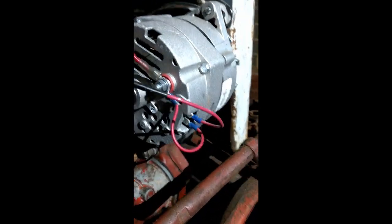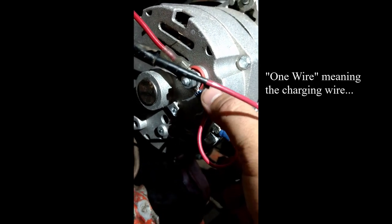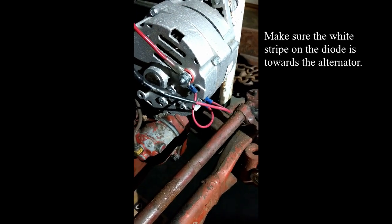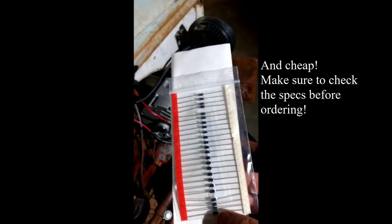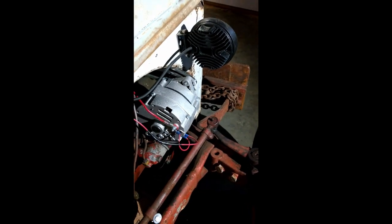Thank you, Google. There was a rubber plug hiding two terminals on this. The bottom terminal here — terminal number two — is jumpered to the one wire. That's constant hot. The second terminal, which is actual terminal one on the top, goes back to the ignition switch. And under here is a 50-volt, one-amp diode. That keeps the current from backflowing off of the alternator. These diodes are very, very small — I literally ordered a pack of 25 for a buck fifty off eBay. They're very cheap, but this protects the circuit from any back voltage.